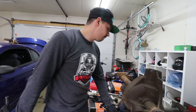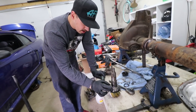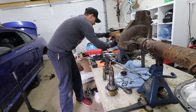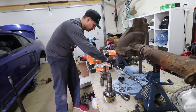Now we've got to pop these races out. Actually, is that a pinion bearing I wonder? There are two different style bearings that come on these pinions. And if you have the race to one already in there and you try and measure it with a different one that's not the same style bearing, then when you go to put the real bearing in it ends up being wrong — it locks up.